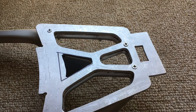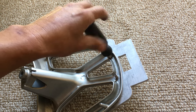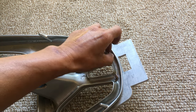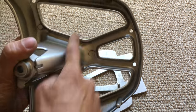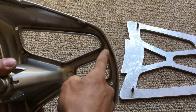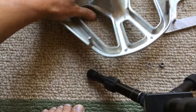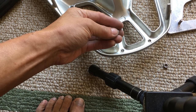Let me take this off first. These screws are 6mm — I'm using stainless screws and nuts, 6mm with a 1mm pitch. I actually marked the rack first and drilled the holes on the rack before drilling the holes on my mounting plate. The space here is very small. I took a washer — there are several types, and these are also metric washers for the 6mm.